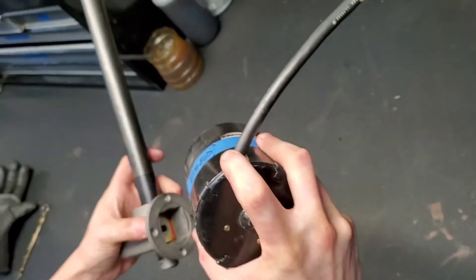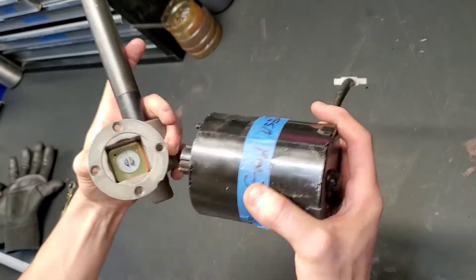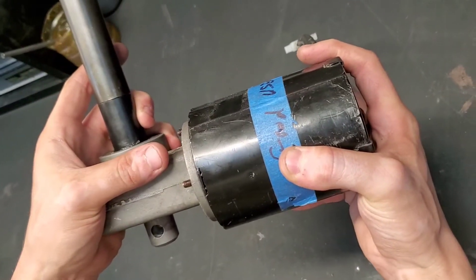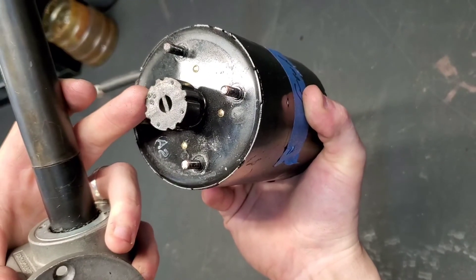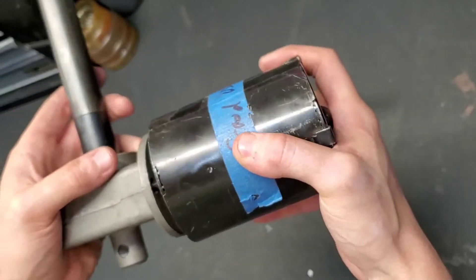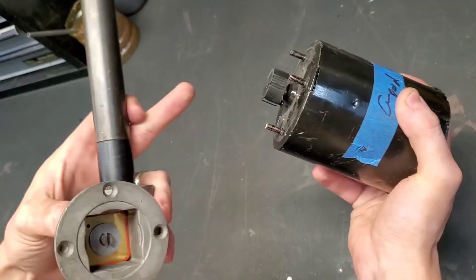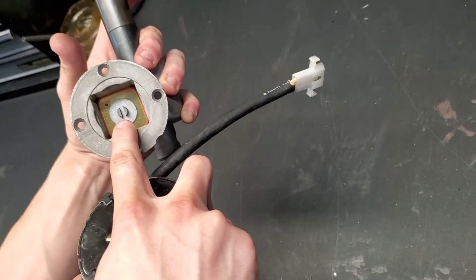You'll want to make sure that the cord is coming out through the top, in line with the actuator rod. Get those lined up. There shouldn't be any extra space or difficulty. If you do have difficulty, you might be able to wiggle the motor a little bit because maybe it got a little crooked. But if you're getting spacing in between, or it doesn't feel like it's mated properly, you'll want to take it back off and make sure that A, the drive joint is all the way in on the output shaft of your motor, and B, that it's lining up properly with the input shaft on your actuator.